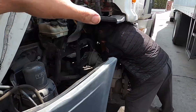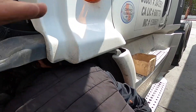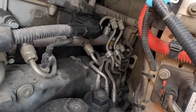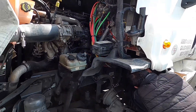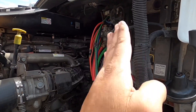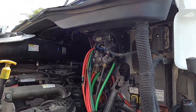First thing we'd like to do is get the accessories out of the way — wheel out of the way, splash guard, fairing, whatever you want to call it, get all this out of the way. Because in order to get to the fuel pump you've got to get all the way in there. When you're working on a Freightliner Cascadia with that short nose, you've got to get as much room as you can, because half the engine is inside the truck and half is out here.